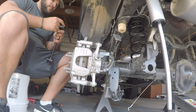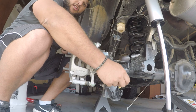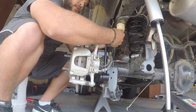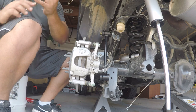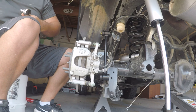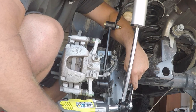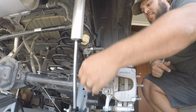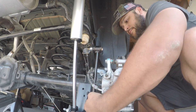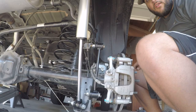The provided hardware is going to go on the top, and then we use the factory hardware to mount to the bottom. Make sure the head of the bolt is facing the wheel. Need a 16 or 18 millimeter socket or wrench. Shocks are in, upper mount of the sway bar link is in, now let's do the lower one. We got them in - hot out here today.